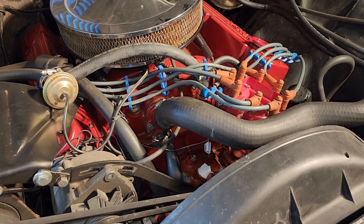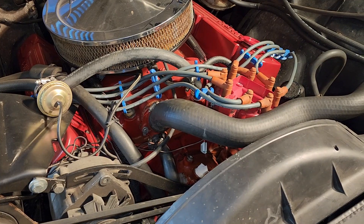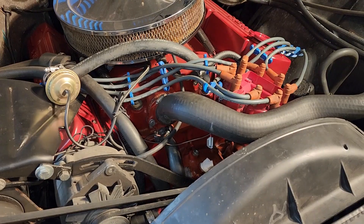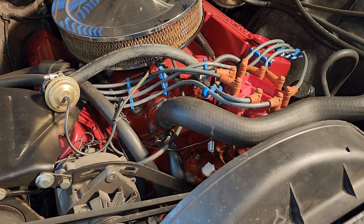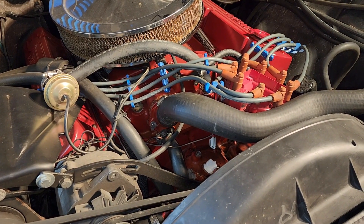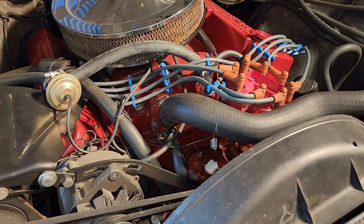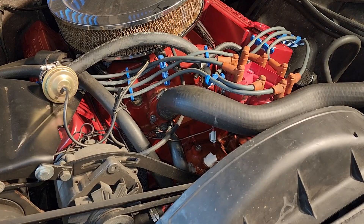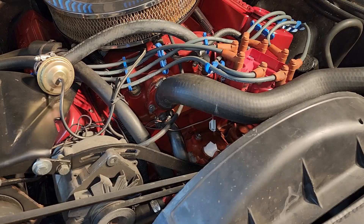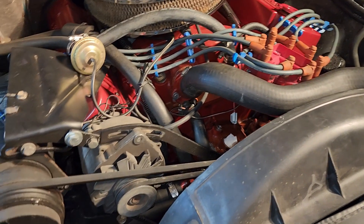It sat for probably a month before I got back to it, and the oil drained back into the oil pan. When I got the filter on there and filled it up with oil, no oil pressure. Not unusual on some of these engines, especially a Buick. I've never had it happen because I've never let it sit that long without putting the filter on and starting the engine.